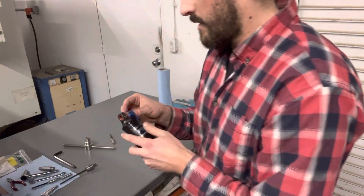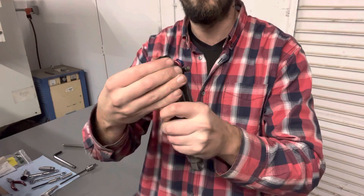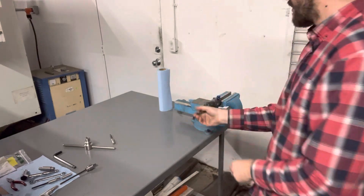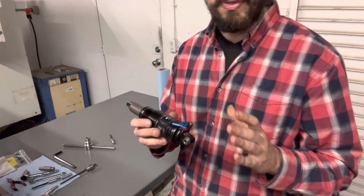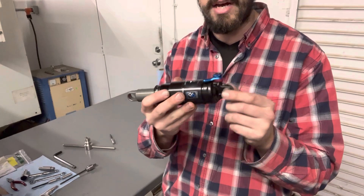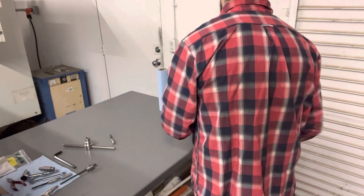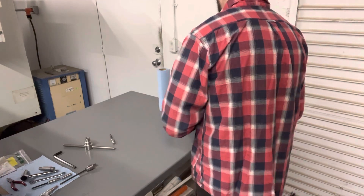Let's feel that after the number three die. Now we're talking — look at that. I can push it with my thumb; it's still snug with no play. And look how much easier it is to move around — that's really going to help with your small bump compliance. What people say is that the bushing on the end of the shock that doesn't get much rotation isn't a big deal — but even sizing one bushing that doesn't have much rotation still makes all the difference in the world. There's really no reason not to do this.